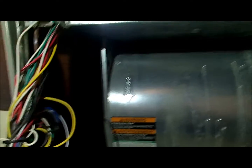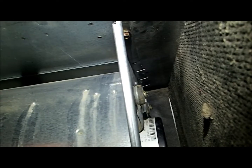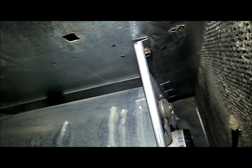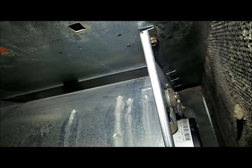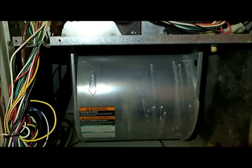I've taken off all the front parts and moved them out of the way. Disconnected the drain. Now we can clearly see the fan. You've got one screw on each side and in the back there are slots. You take those out and you should be able to slide the fan right back and out — it slides on those slots in the back. So one screw and the slots over there — that should be it.